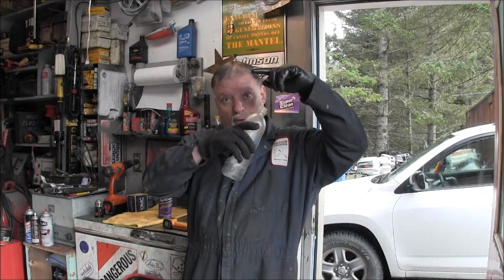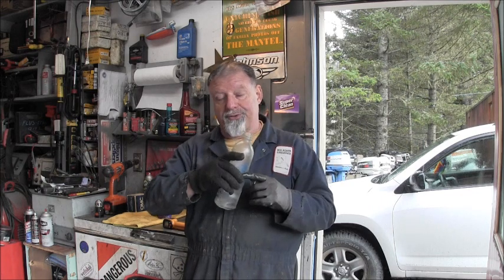I've seen them where both the water pickup tube and that little short piece of copper discharge or exhaust tube, or whatever you want to call it, I've seen where the grommets are completely full. I mean, virtually no water was getting through. Maybe just a little spittle here and there. So this one wasn't even that bad, but it ran hot. So we can't have none of that around here, you understand?